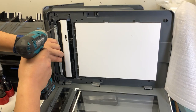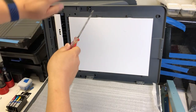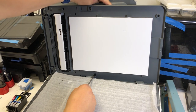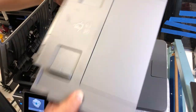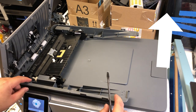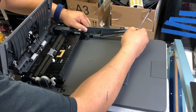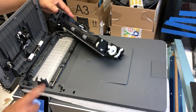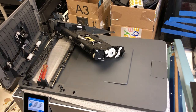Now open the scanner and remove two more screws and take off this metal piece. Then get a flathead screwdriver to push this tab in, and another one on the bottom — push it in. This paper stacker can be taken out. For spare parts, I'm going to put a link above so you can click if you need an extra stacker. Now we remove this long piece from the bottom. This long piece on the top is harder to remove. If you already see some debris on the trigger, you can just clean it without removing that long piece. Otherwise, this is how you remove it.